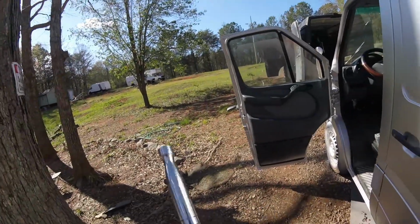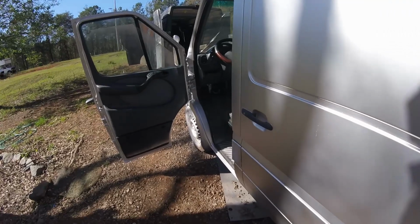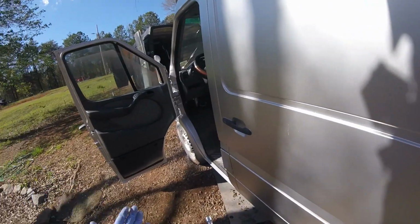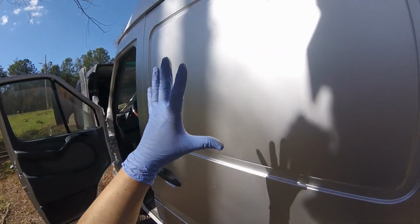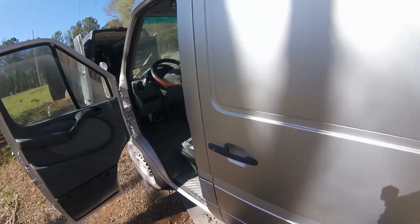That window has a rubber seal, and one of the guys said, all you need to do is have a string that's the size of the ones used for blinds. Put it around the molding piece, maybe lubricate it or something, put it in there, and have somebody hold the glass on the other side, and you just pull the string and it's going to install itself. So it seems like a very interesting idea.